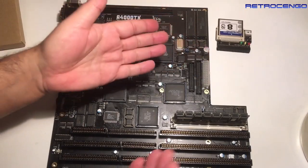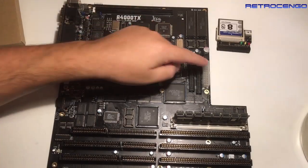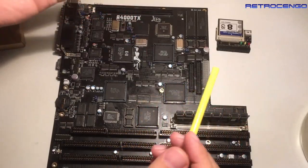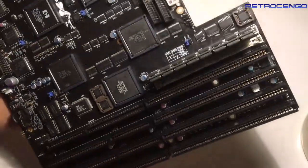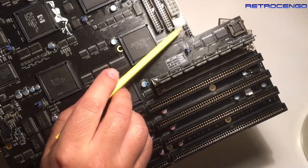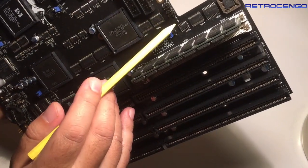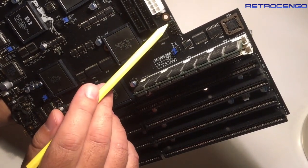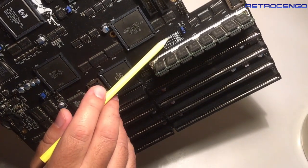Over here, you don't have to use a 20-year-old Commodore PSU. You can just use a brand new PC PSU and give it some quality power. Isn't that just great, man? I love that. Over here it says power switch. This one says hard disk activity. This one is power LED, so you can have a green LED that's lit. And this one is for what? It's for reset. Nice.